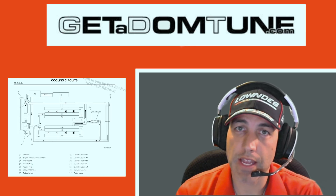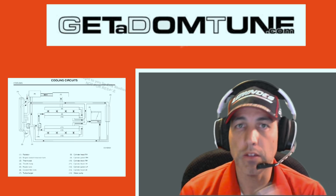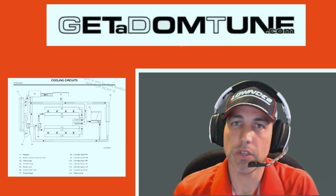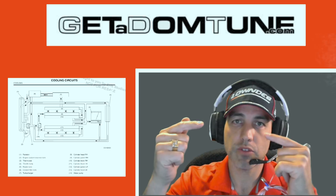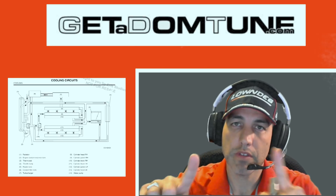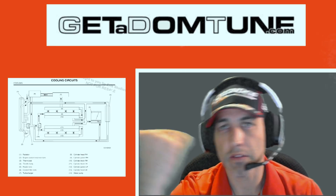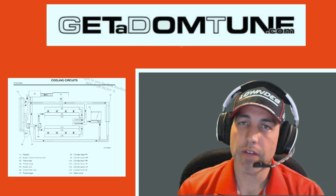If you look at the design of the cooling system on that side of the engine, it's very apparent. On cylinders one and three, the coolant enters the bottom right between cylinders one and three, goes up to the bottom half of the cylinder, into the head, up over the shape of the chambers, back into the cylinder sleeves, out the center, across the crossover pipe, and out the front to the radiator water pump on the driver's side.